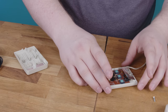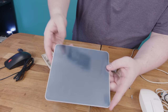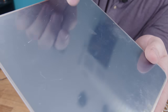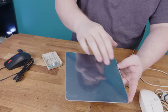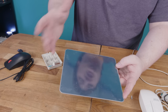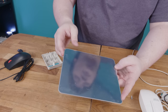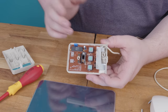Most surfaces don't react differently to different wavelengths of light in a consistent way — that's not really a thing. So it seems pointless, but the reason is that this mouse does not work on most surfaces. It actually takes a special custom mousepad, and a real exotic one — it's actually a piece of aluminum with a fine-pitched grid printed on it. Half the lines are blue while the other half are a grayish color. This is where the two wavelengths come into play: the blue lines appear black under red illumination, while the gray lines appear black under infrared. Each LED only illuminates its matching color of grid line, and the other ones won't show up, so the image cast on each sensor will only show the information it's interested in.